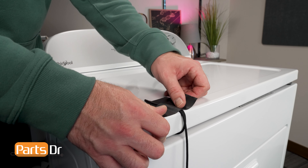If you need to purchase a new door spring, make sure you get a manufacturer certified replacement part like the ones that we sell on our website, PartsDoctor.com. We'll leave a link in the description below. You want to make sure that you're searching with the model number from the tag on your dryer to be sure you get the correct part. Using pliers, attach the springs to the hinges and the hole at the bottom of the panel, referencing their orientation as to when you removed them.